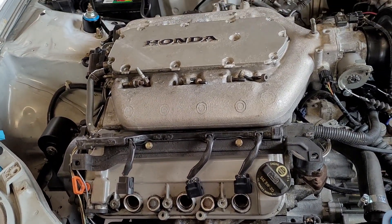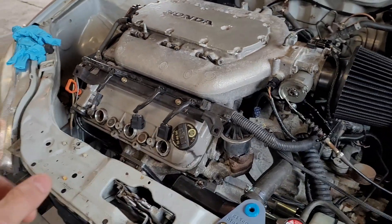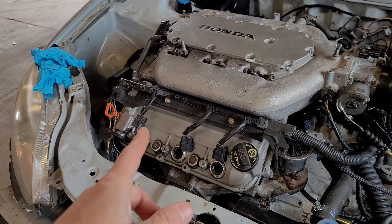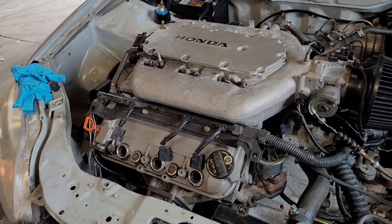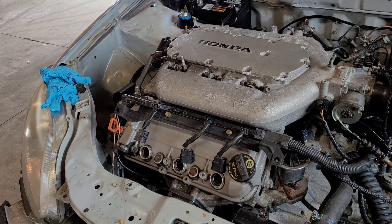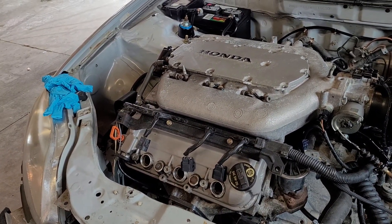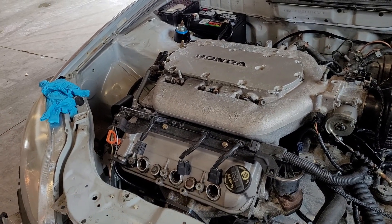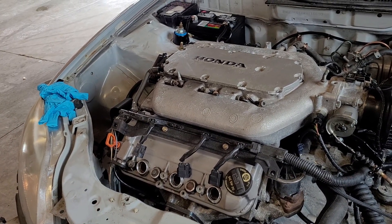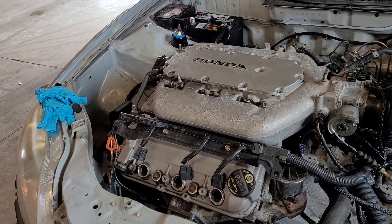If you have individual drivers for the coils — on this car they're paired — you can check to make sure the output you're intending reaches the correct coil before you even hook anything up. With the spark plugs out, you can crank the engine and it's not going to start — you have no fuel pressure, so it's not going to start.